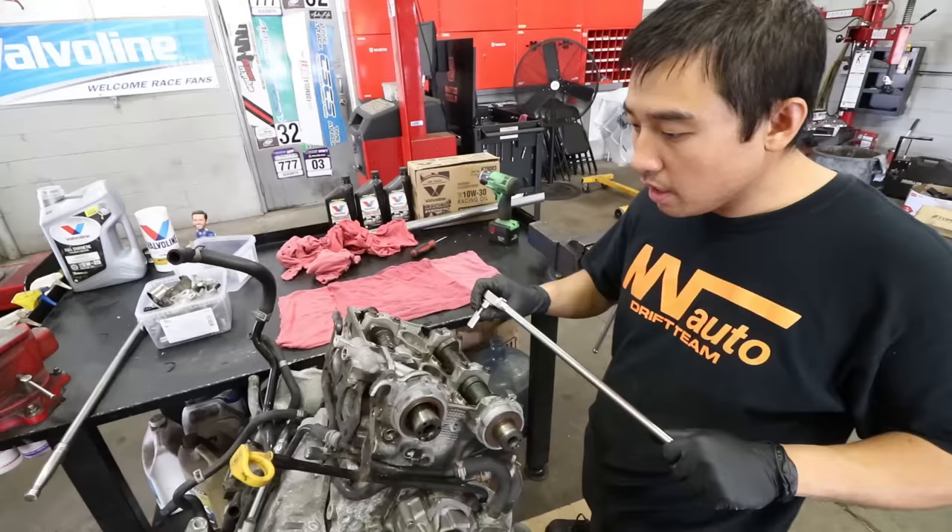It is officially time to split this puppy open. We lay it on its side and work this half off — which requires a lot of work on an older engine. Some of the newer ones are a little bit easier to split, but we just have to apply some force without damaging the case half. And there she goes — it's a strange concept, a two-piece engine block, but clearly it works.